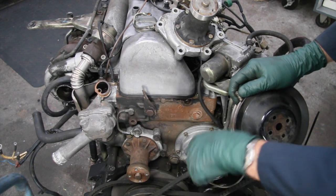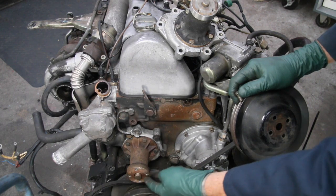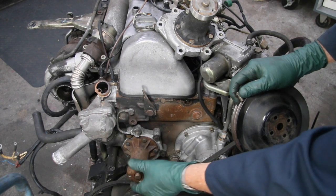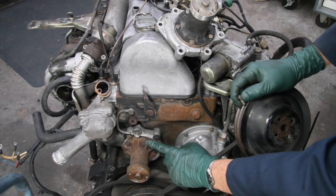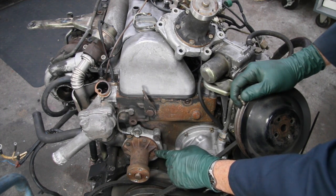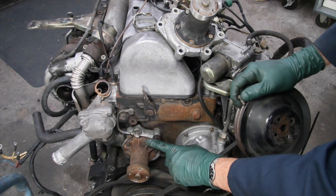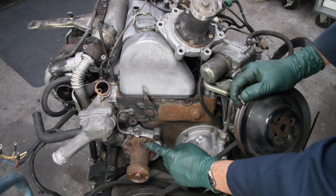You would think changing the pump isn't difficult. We have a kit on the website with a special tool that helps you get these difficult-to-remove bolts out of the fan clutch. But when you start removing these bolts, this is where you have to be very careful. These bolts are known to break off because you have a steel bolt going into an aluminum housing — there's an issue with dissimilar metal corrosion, and if you try to spin these out without care you can break them off.